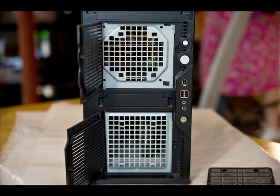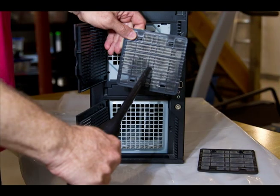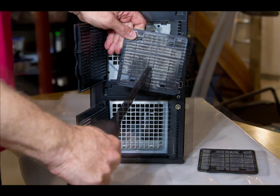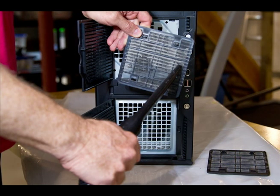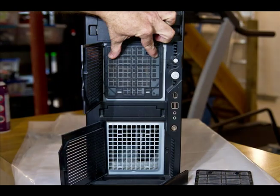At the same time, you'll see the metal grate behind the filter. You can go ahead and vacuum that out as well if there's additional dust there. Always make sure you vacuum your filters from the front — you don't want to pull dirt and dust back through the filter and get it clogged in the screen. To replace the filter, fit it back in the metal slots, push down on the tabs, and snap it in place.